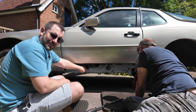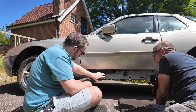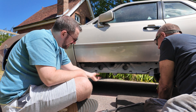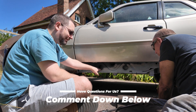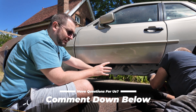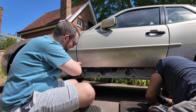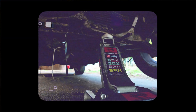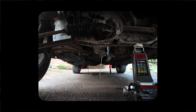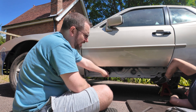On these cars, the issue is the water — you can see how bad this is. Water gets into this area of the car, and when it's really bad — and we're lucky that this isn't really bad — water fills up and starts corroding this part that you can see, but also the bit that we saw inside the car where the seats are. Once that starts getting corroded, the job to fix it is an absolute nightmare. You basically have to cut out everything that's bad and brace the car in a position so it stays square, because it will begin to flex once you cut this out. You brace the car, cut out all the bad, then put new metal in and fabricate it so it all marries up nicely. That's why once the inner sill goes, you're talking about a £10,000 job on a car that maybe isn't even worth more than £10,000.